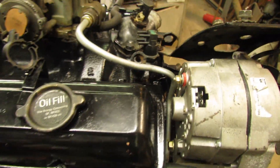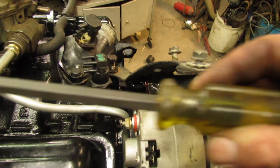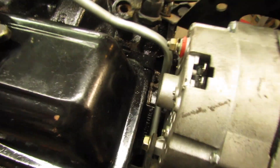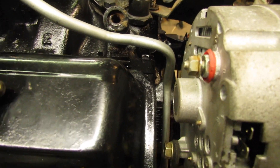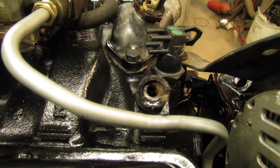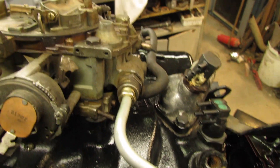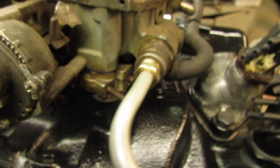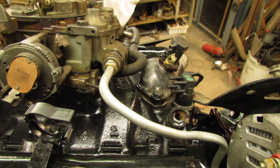There's the flare and the nut, now let's put it up and see what it looks like. I think we're looking pretty good except for right here - but I think I can get that out of it with a little gentle persuasion. I think it turned out pretty good. That's about where the alternator will sit with the belt on it - we've got a good three-eighths of an inch clearance everywhere. We've got clearance on the heater hose, not excessive but we've got some. We can still get the valve cover off and it's in the carburetor. This problem was exacerbated by the fact that I had to cut my flare off, which shortened up this run and brought the line closer to the heater hose - that's why you've got to pay attention and not get distracted.